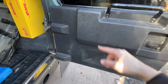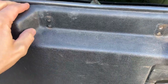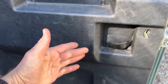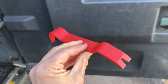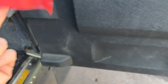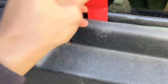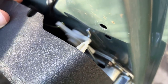I've done that before when I messed around with the rear wheel fitting. The little handle comes off, those screws come off, that frees up the top bit, and then that whole thing just unclips and comes straight off. The best thing to use is a trim removal tool — I used to use a screwdriver but I damaged a lot of trim that way. I'd really recommend a set of these; they're like £5. You literally slide this down the panel, give it a little push, and they pop out — super easy without damaging anything.